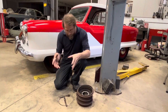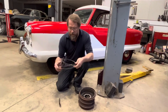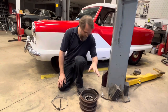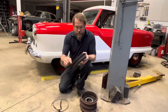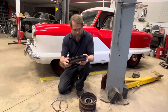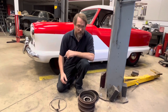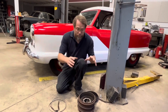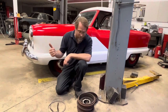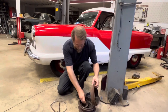We also got into the parking brake cable, which was completely frozen up — could not get it to move at all. That was preventing us from getting a decent adjustment on the rear brakes after replacing the drums. The drums were 30 thousandths over the maximum recommended diameter, meaning we were really at the end of the adjustments, and they were slightly out of round too. He had brought new drums with him, so on went the new drums. We also put new front shoes on because the right front had gotten kind of hot and we were starting to lose material off the shoes.